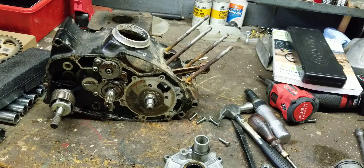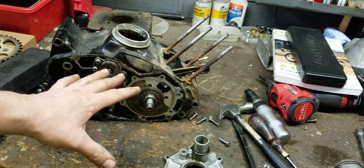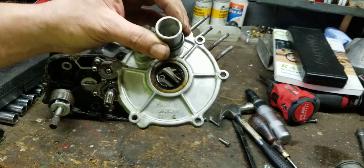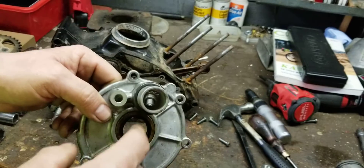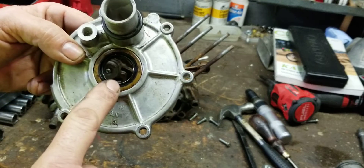That's how it works and that's how you correctly install a valve and how you can tell if it's incorrectly installed. The bottom part of the piston does a lot of work on a two-stroke — it's that simple. Hopefully you found this informational. It's very important — your bike won't run with it wrong, and if you did get it to start you'd have no power. I also want you to learn something about your crank seals: on these rotary valves there are more than just two crank seals.